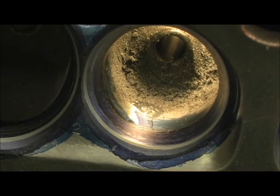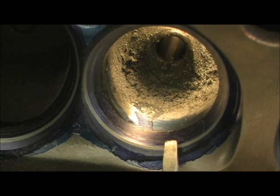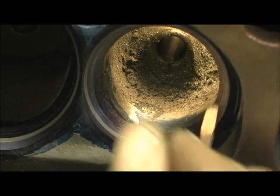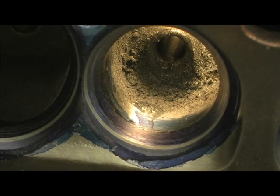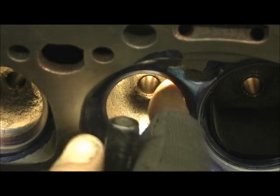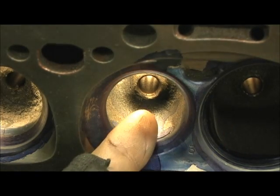So I've got 90 thousandths width of the 70 degree angle from the edge of the seat in where I begin the cut. You can't see the line, but I can — there's the gray line, that's my seat. The little line is right there, 70 thousandths. I'm going to totally conform this and pull all that out because the size hole that the exhaust is seeing is a 1.300 diameter — that's 300 thousandths less than the 1.60. You can see the concern: the seat has got some kind of radius, but it just chops the hole size. We've got to get that opened up in order to make the 1.60 a viable valve to be able to exhaust the gases.